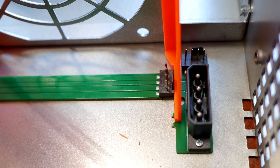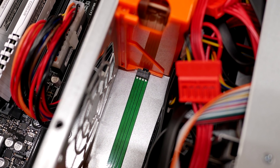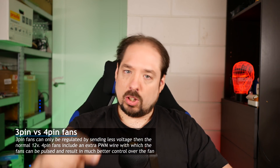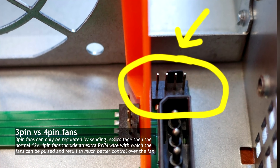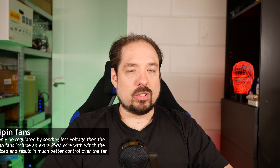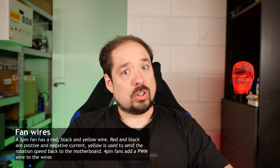During building, I noticed an interesting feature on this server. It includes a fan PCB which seems to be built for using 4-pin fans, while the included fans with the chassis were only 3-pin fans. I then noticed that next to the Molex connector, there was a 4-pin header to which you could also connect a 4-pin fan — but connecting a fan there did nothing. So I wondered: maybe you can connect it to your motherboard and it'll relay the PWM signal and the tachometer fan signal, so the motherboard can measure how fast the fans are spinning.